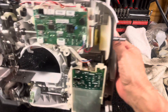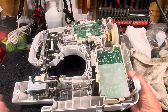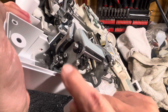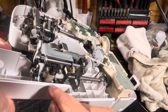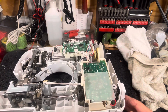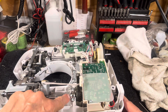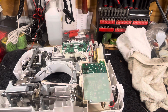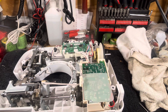Once you get that cleaned out, make sure you address the bottom bearings — we talked about the top bearings, and there's a bottom bearing over here on the left side. Oil both sides. You've got to clean the gear out because it'll be full of debris; oil the ends of it. You don't need to oil the gear itself because it's nylon. Oil the left side and the right side, and you might even want to oil the plastic idler in there a little so it doesn't squeal.